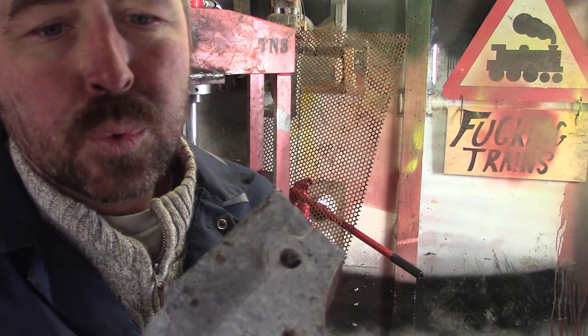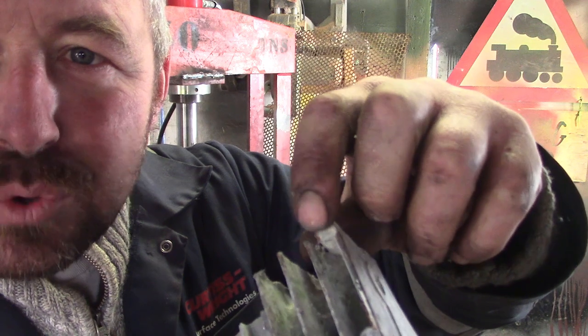The liner is actually in the mould, and the aluminium is die cast around it. It's definitely a die cast thing. You don't normally have these sort of pips on something that's been sand cast. They're completely unnecessary. These are the sprues, if you like, or the vents, for injecting the alloy or letting the air out of the mould, isn't it? So yeah, interesting stuff indeed.